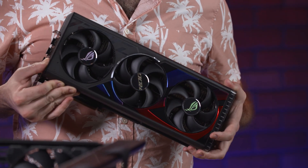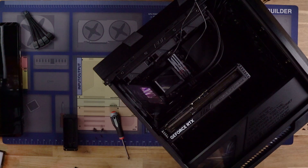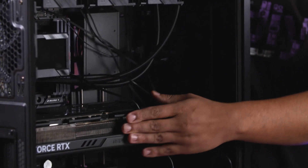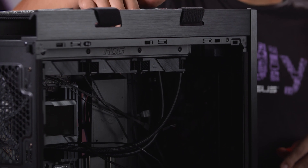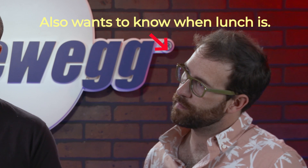This time I'm going to let you install the GPU. The main thing you're looking for when installing a graphics card is to make sure the bracket is flush with the chassis. Graphics card is installed, secured, and we can see the overall look and feel of the system coming together. As a recap for the AIO cooler connections: one USB cable goes to a USB 2 header on the motherboard; there's a micro USB connector going to the controller; fans connect to this controller; ARGB cables and PWM fan cables connect to the controller; and there's also a SATA power cable connecting to the power supply.